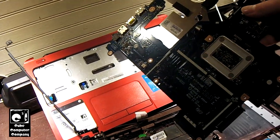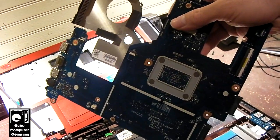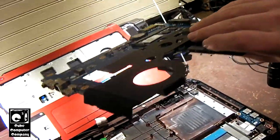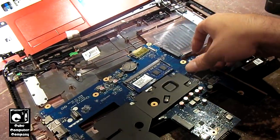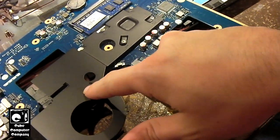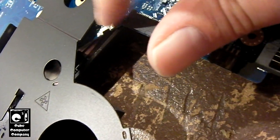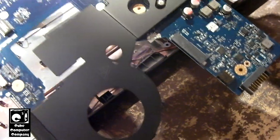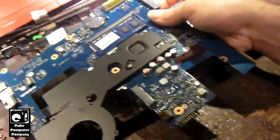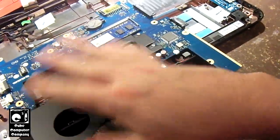It failed for a different reason than overheating, but I'm pretty sure if we were to throw some stuff at that CPU it would probably throttle after a while, because the heat's got to go somewhere and this piece of metal can only take so much before it starts to get saturated with heat. I love how they have this little fan symbol there — what fan? There's where the fan would be soldered to the motherboard — well, there is no fan on this one. None. But on the flip side, if I could find a set-top box big enough to fit this motherboard in, I could use a chipset heat sink that would probably provide better cooling than this junk right here.